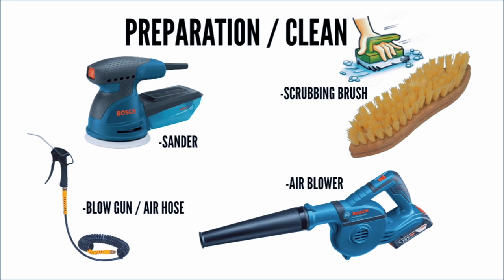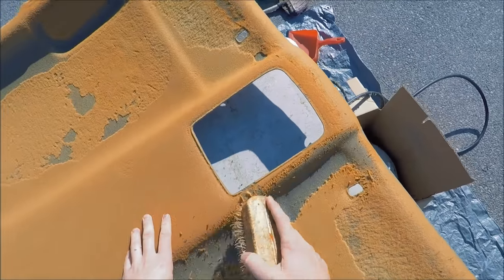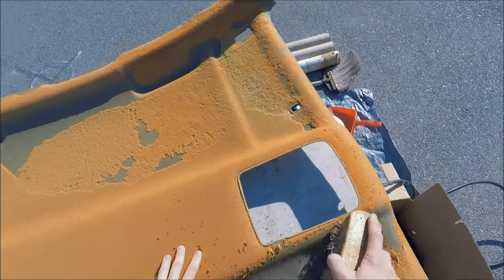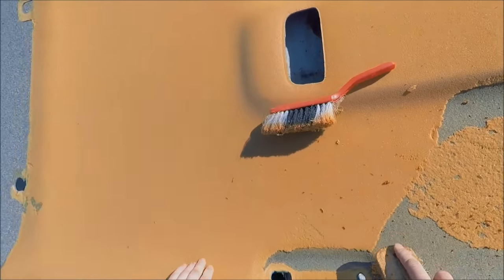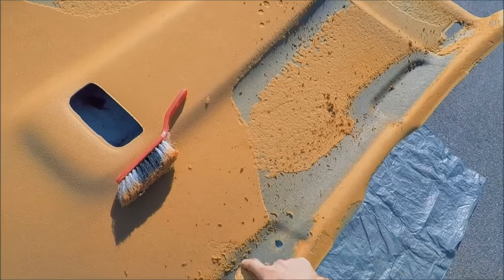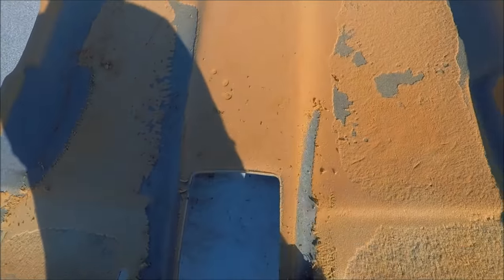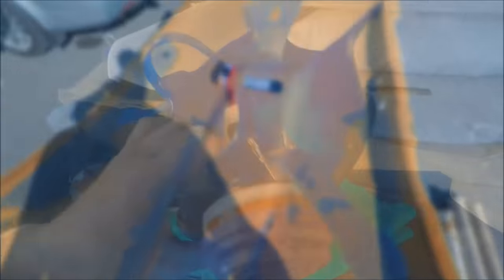We're moving to the preparation and cleaning now. A scrubbing brush is mainly the main item that you need here to remove the old original foam. You want to scrub the board nice and clean and get off all that foam, getting the board to a nice clean surface ready to apply brand new glue and brand new material. If the old foam is difficult to remove, you can use an orbital sander, but only if the headlining board is strong enough to withstand a bit of sanding.